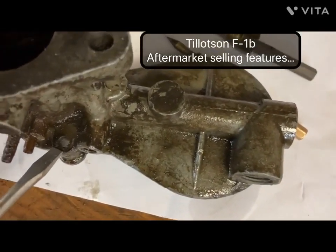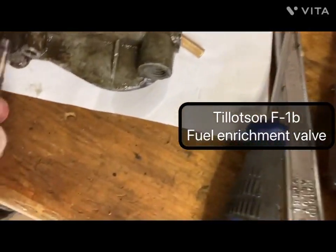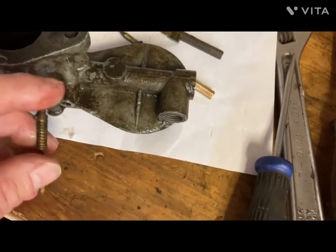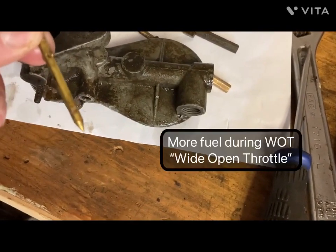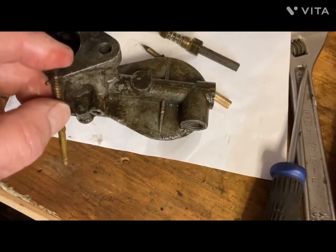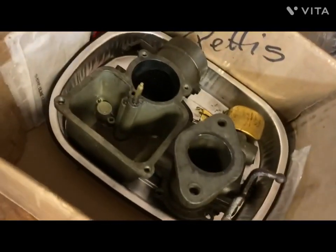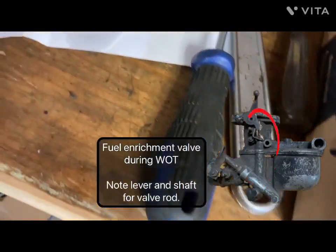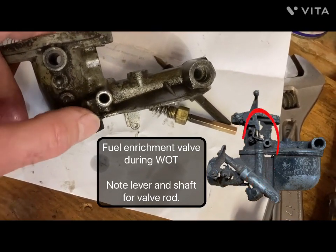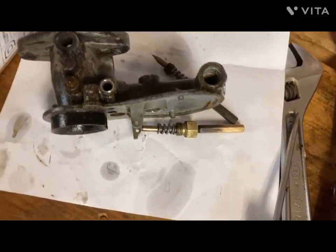This little hole right here is an additional fuel inlet, so this part comes up through that hole right there. There's a lever right here, and when this comes up it releases more fuel to the mixture — sort of like an accelerator pump, but it doesn't squirt it in like a modern carburetor does. It just lifts this rod up and allows more fuel in. So that's when the throttle comes around and moves the little lever on this lower pivot here, and that rod inside there comes up and releases more fuel. I'll show you that once I get the carburetor back together.